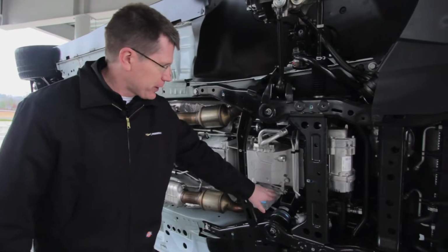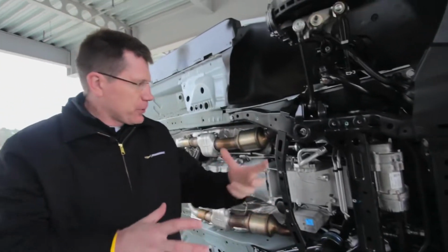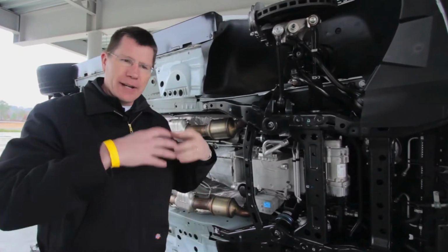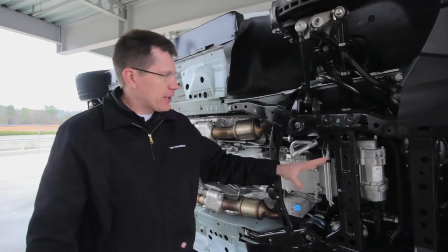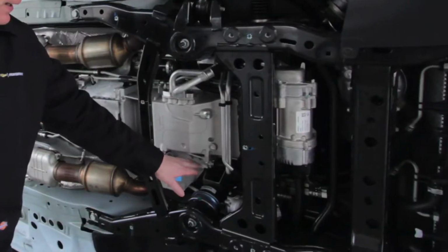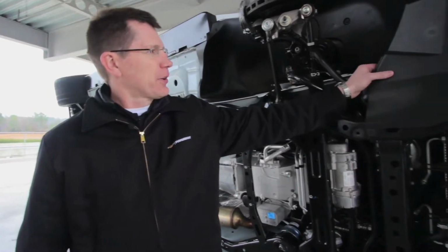in a Corvette Z06. You can see the dry sump lines here come forward up to the dry sump tank in the front of the car, and that's so as we're running the car hard on the track, we've got a nice vertical column of oil to keep the oil pressure squared away, keep the engine reliable and durable. That's another carryover system from the Corvette Z06, so it's very tested out. We just refined it for the Camaro Z28, and with this package, the whole cooling system works a lot better.